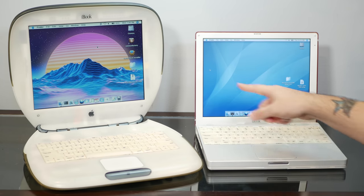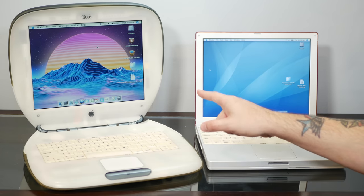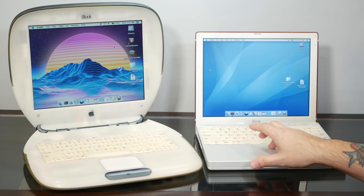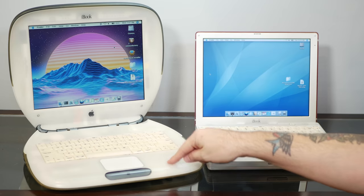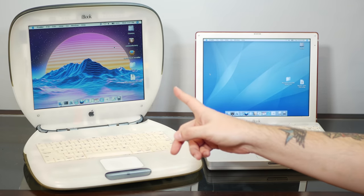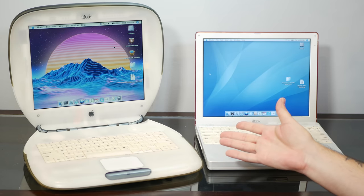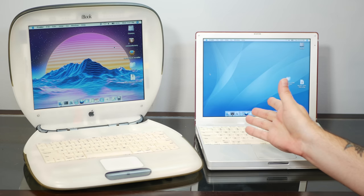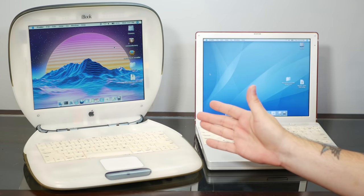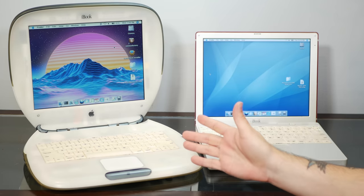This screen is technically compatible with this machine — specifically the 466 and 366 Special Edition — because these have 8 megabytes of VRAM as compared to only 4 megabytes in all of the previous clamshells, so this machine can support 1024x768. It's a bit of a chore to get this screen into this machine because aside from it not quite lining up with the brackets, you need a special cable to go from this display's connector to the iBook's connector, and that cable only came with about 12% of the clamshells sold — only the ones that had LG screens. Since the screen in this one is Samsung, we're either going to have to build our own cable or solder the connectors directly onto the pads on the LCD itself. Then with a little bit of open firmware hacking, we can have an extremely livable 1024x768 on this clamshell iBook.